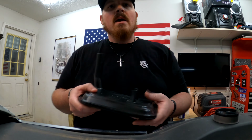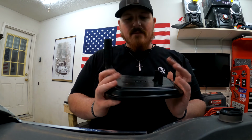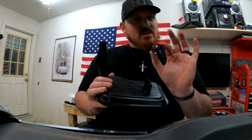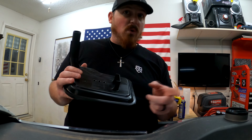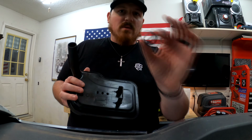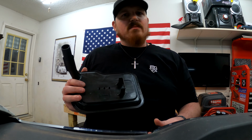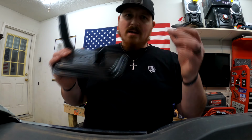Now, here's the thing. If you pull the old one out, don't go ahead and rip the old seal out. If you try to install this, which you might as well just go ahead and try, and it fits up in there nice and snug, I would not replace this just yet. Simply because if we're going to be swapping the fluid out 3 to 4 times before I try and install a torque converter, there's no point in replacing this if it's still sealing. You can replace this part when you're done, like on fluid change number 3 or 4, go ahead and pop that old one out just for safety reasons. Throw this one in there. Make sure it's got a good tight seal. When you press it up inside the trans, you won't have any issues.